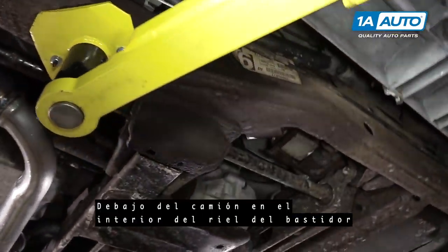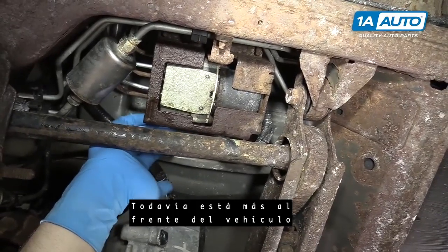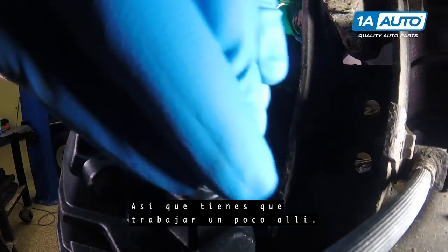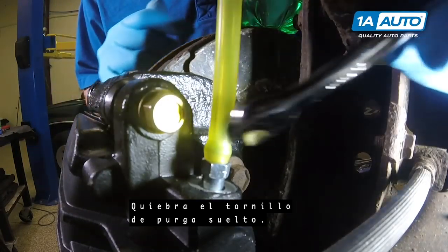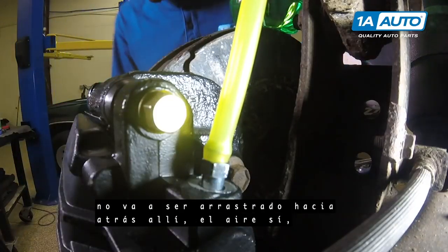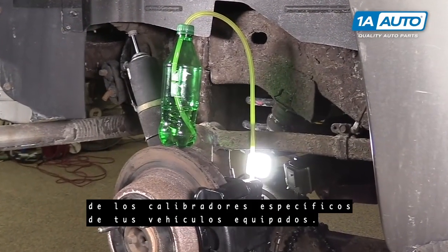Underneath the truck on the inside of the frame rail, this sits actually just about dead under the driver's seat in the front. So our ABS module is not located in the engine bay like the majority of them are. It's still more to the front of the vehicle, so the bleeding procedure will be the same. Our 3/16 fuel line is actually just a little bit smaller than the bleeder fitting, so you've got to kind of work it on there a bit, but then it's on there good and tight — you get a nice seal. Just crack your bleeder screw loose. You don't want to spin this out much more than about a quarter of a turn because anything else could cause it to leak out of the side of the threads, which obviously means fluid isn't going to get pulled back in there, air is, and that's going to defeat the purpose of what we're trying to do here. Ours happen to be a 10 millimeter open end wrench to open those bleeder screws. Yours might be a different size depending on the specific calipers your vehicle is equipped with.